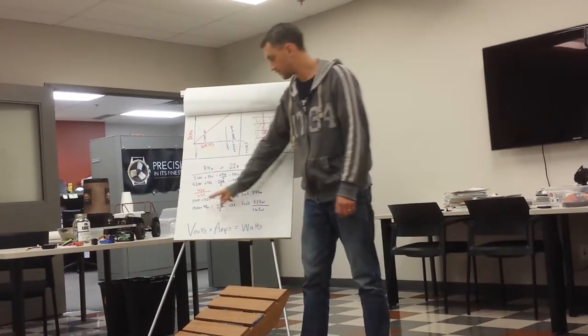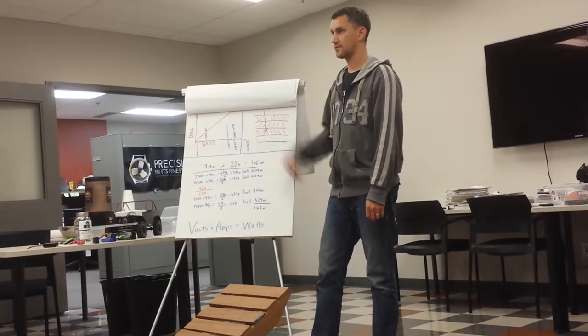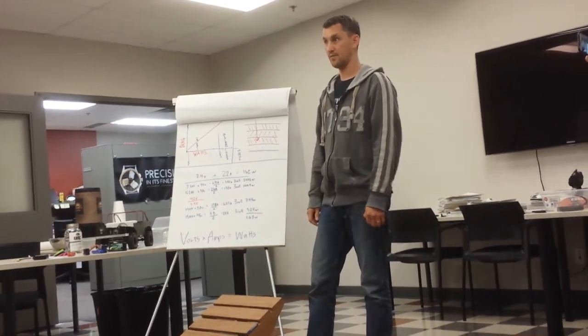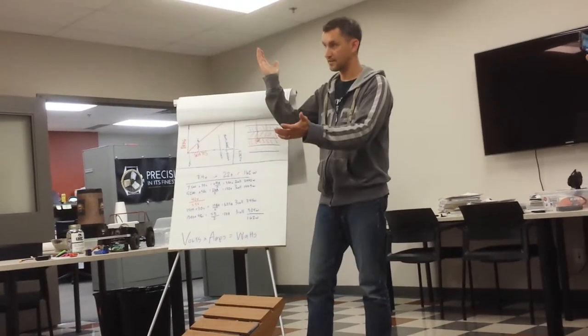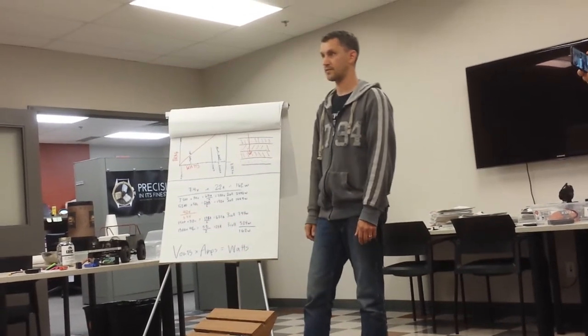Puffing batteries, 99% of the time, happens because they're running below operating voltage. That's when most of this decay happens. If you have a voltage cutoff setting on your truck or your ESC, set it to like 3.5, because the hit current is still going to dump just below that. And then you want the batteries to shut off before you get into this danger zone where it starts to really cook stuff.